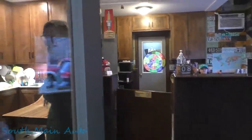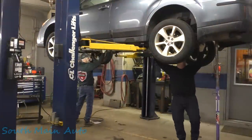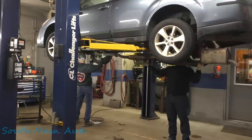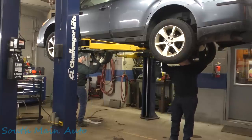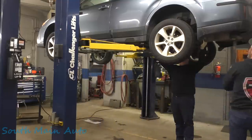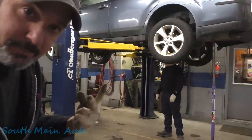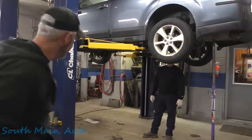You're so good today. Keep the stand out there. Okay, just watch that middle joint. Oh, shut it back up. You gotta hold it. I got it. This guy forgot to unhook the oxygen sensors. Round two, folks: front oxygen sensors, two of them, passenger side. Had to take the plastic guard down in front and unhook those. Now we're gonna try again.